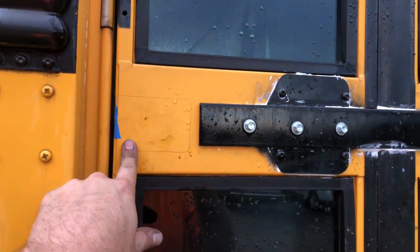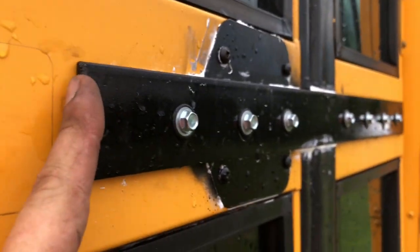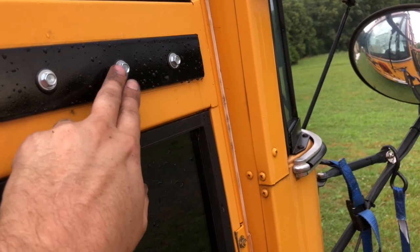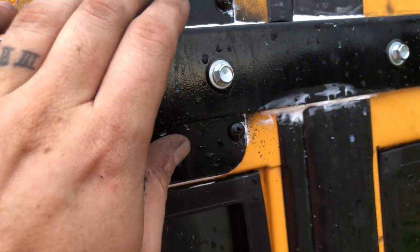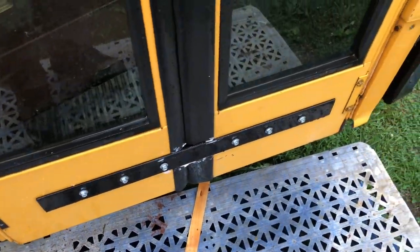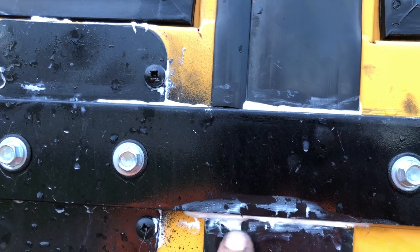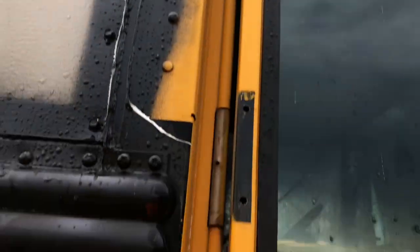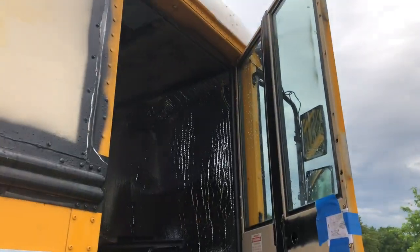What we've done here is attach a two-and-a-half inch by quarter-inch steel bar. I pre-drilled three holes and then four holes slightly larger in diameter than the screws, then used self-tapping screws to hold this bar to the door. I also made a plate to cover the hole from the original handle, and attached a bar across the bottom. I cut out some of the door seal to allow the bar to sit flat, then unbolted the door from the original hinges - now we have a one-piece door.